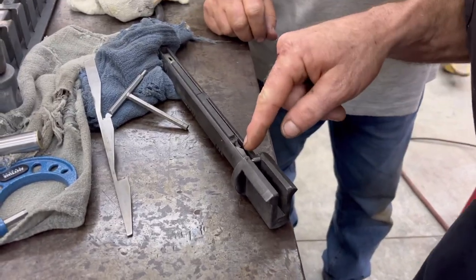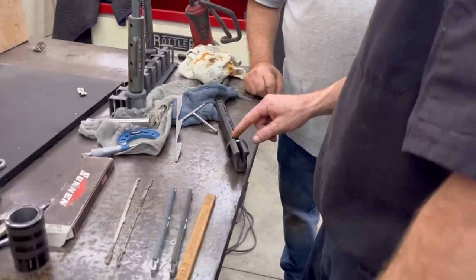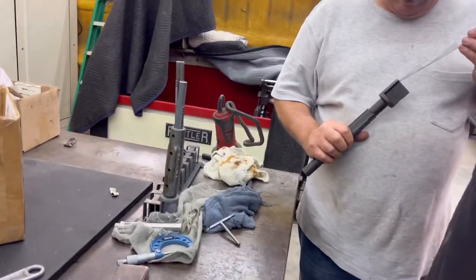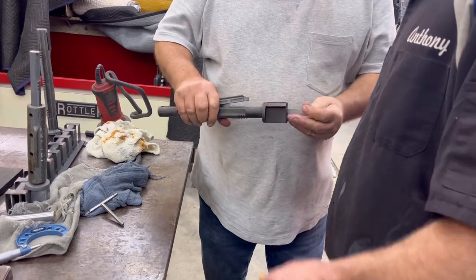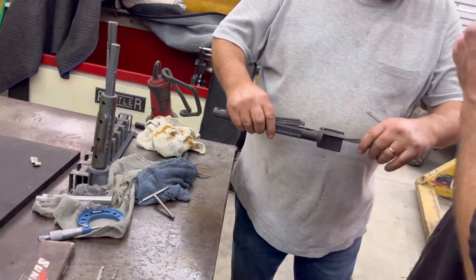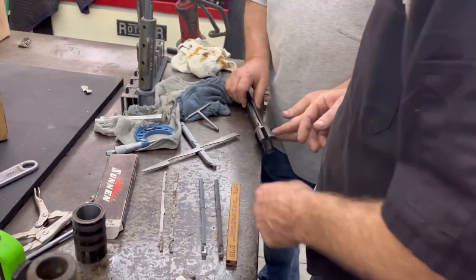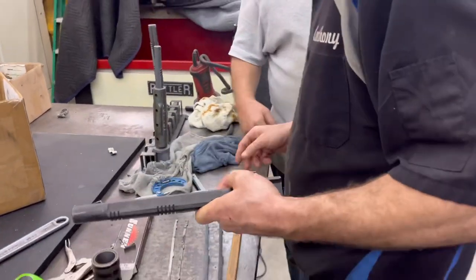So it doesn't go behind it or anything? No, that keeps it from flipping out when you're coming out. That's all it is. The wedge isn't in there, but a lot of these mandrels, you can sneak a wedge in. Normally you put the wedge in, but the wedge has to go on top of that shim I just put in. So you can take the shim out and pull back all the way to here. There you go. Now put a stone in.